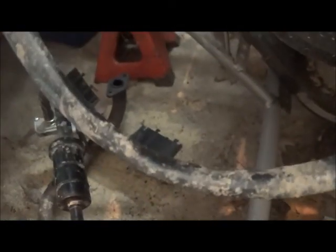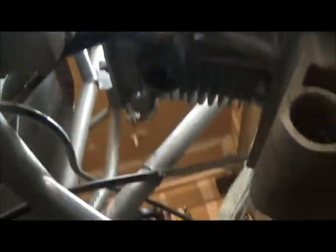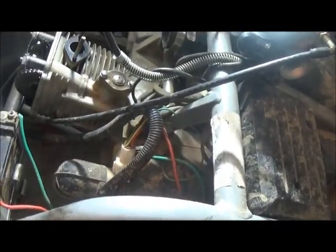So you do have to take the exhaust off all the way back from here, the bolt right here, and it goes into this rubber grommet with a washer on both sides of this rubber grommet. And then there's just one evap hose that I disconnected, and then the whole exhaust system will fall down, and you're left with the cylinder head with a hole in it where the exhaust comes out. And then I removed one other piece, the valve cover, just because it was getting in the way. It's a rather large piece, so I removed that as well. Trying to remove as little of hoses as possible because this thing looks like a plumber built it, and there's a million different hoses.